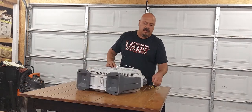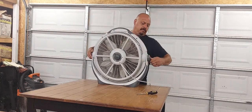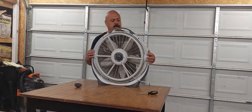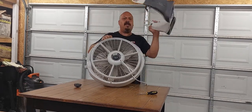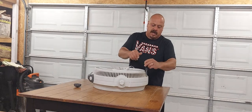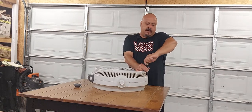What we're going to do first is the two sides right here — you're going to unscrew those all the way. So you get those two, pull this out and take the fan out. Don't forget, you got to wash this too. Then you have four screws — Phillips. You get a Phillips screwdriver. Unless you're one of those guys that like to use power tools for everything, you might strip it. So just letting you know.